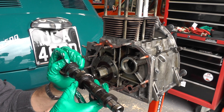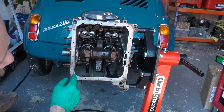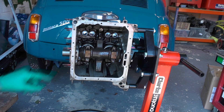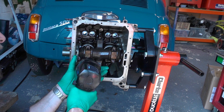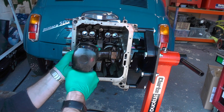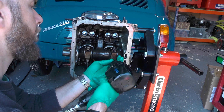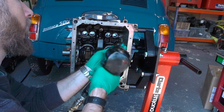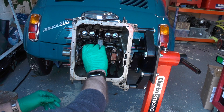We are actually replacing it with a different profile, but that's good for now. Okay, now we have our pistons and crank here, looking at the bottom of the engine, and we're going to take the bearing holders off. These are 13s, one and two, and we should just be out of the bottom of the engine.